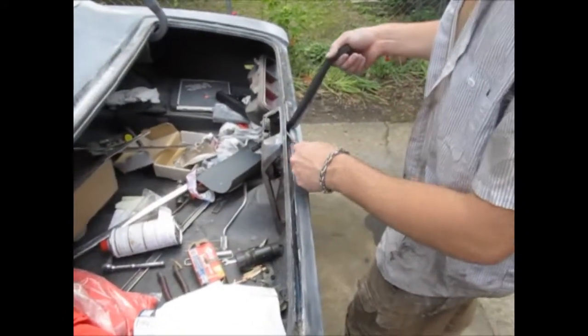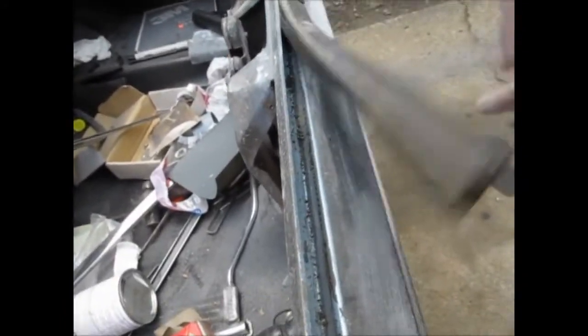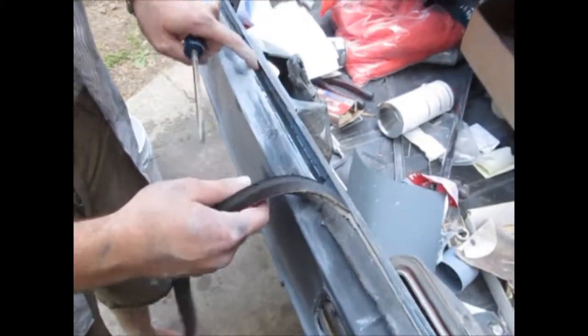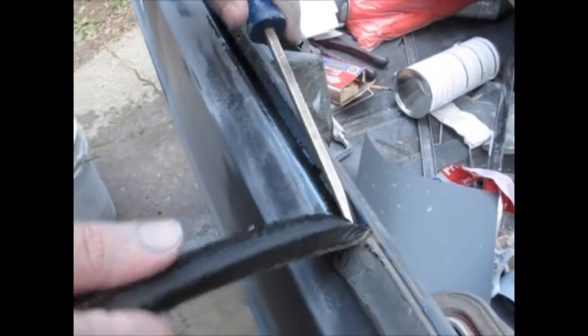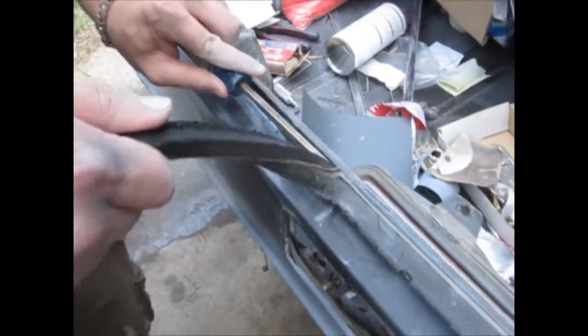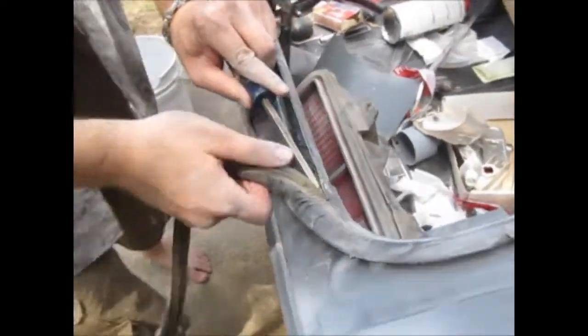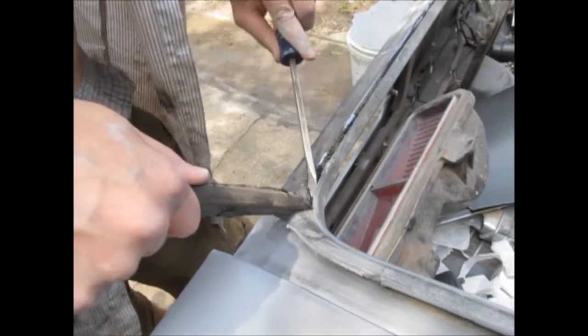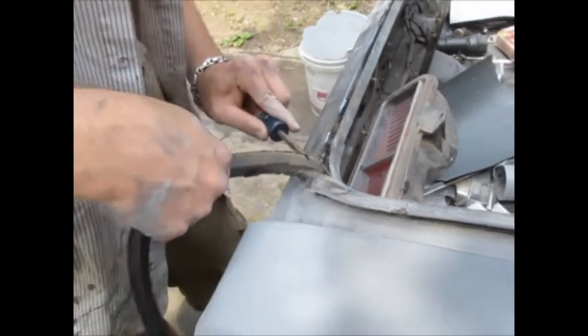See this is how you get in there. See the seal? It's a bad seal — look, that still looks bad. You can see the sand from where I sandblasted coming out of it too. It's just taking the glue. See how it's glued here? Got the screwdriver behind it, going in here, staking it out, separating it from the glue and the body panel. Then we'll be able to get in here and clean this up too, have it all pretty.